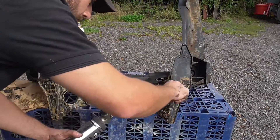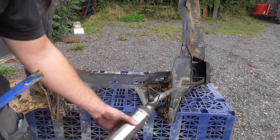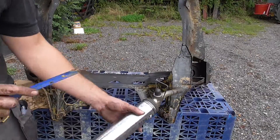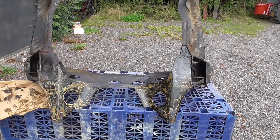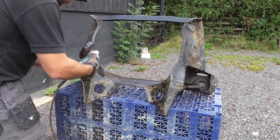The preparation process for the front subframe is exactly the same as what you saw on the rear, however as there's much more of that original protective wax present here, the first stage is removing that with a blowtorch and a plastic scraper. After that it's back to the wire wheel to take this subframe back to bare metal.